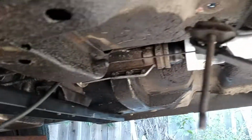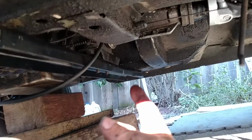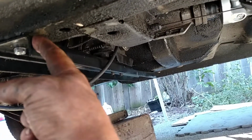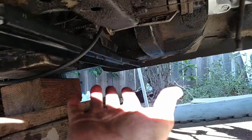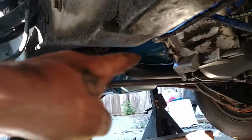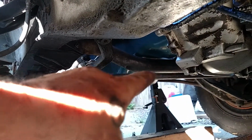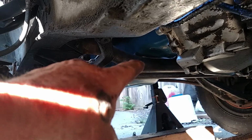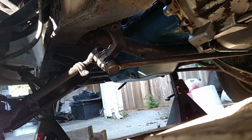It's in. And my transmission mount is a little high right now, so I might have to put in some sort of gap right here, a spacer of some sort, to lower the motor. But I'm noticing the motor doesn't have much room. Right down here, there's the bar. It goes across underneath the motor, and so there's really no gap there left. There's really no more room to lower this motor.